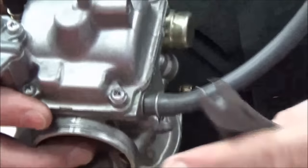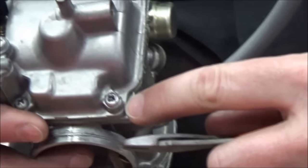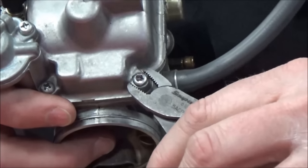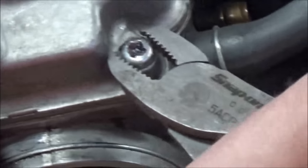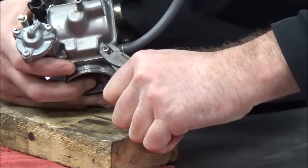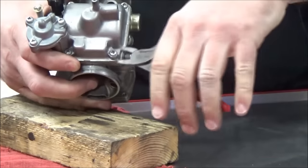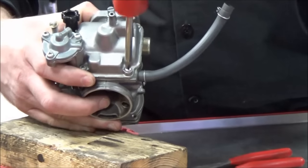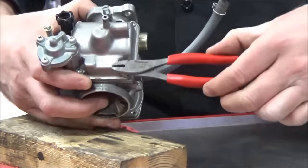Check this guy out. I've got to make sure the teeth are not grabbing onto the bowl too closely — I want to be up on the screw. And since I know which direction I'm going, shouldn't I preload this as far away as I can? Look at the death grip I can get on this. Then I can go ahead and break it free. As soon as it's broke free, I go back to a traditional tool, take it apart, and move on. Way cool tool — absolutely saved the day.